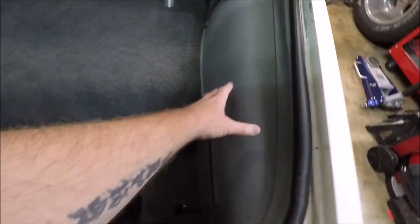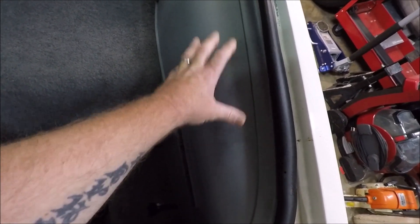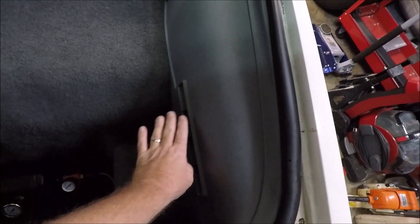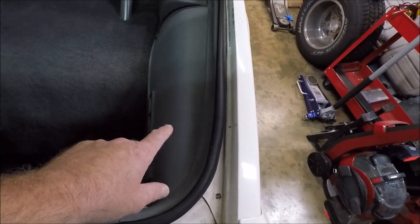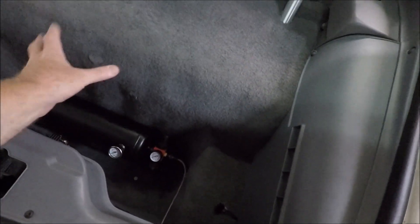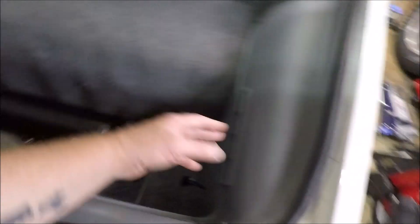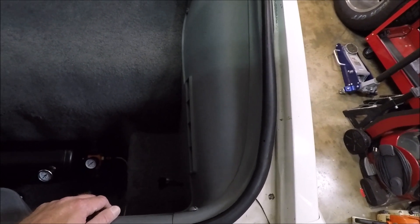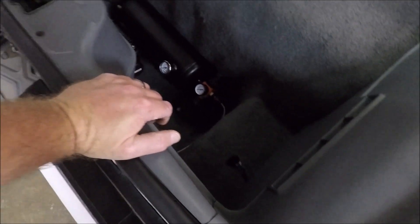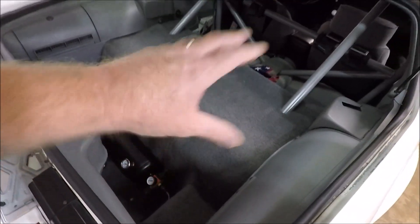When I wired this up, I actually have a whole fuse and relay box mounted right back here inside above my battery. There was already a fuse and relay with 10-gauge wire that had previously gone to my nitrous bottle warmer back when this car was on the bottle. So basically all I did was run those wires to the compressor and put a new label on the relay — instead of saying bottle warmer, it now says onboard air. Pretty simple.